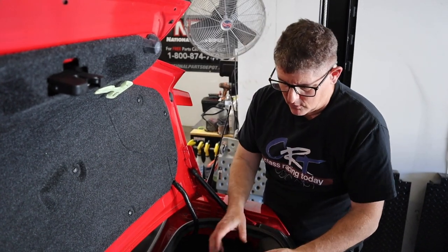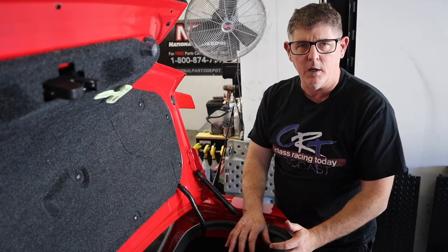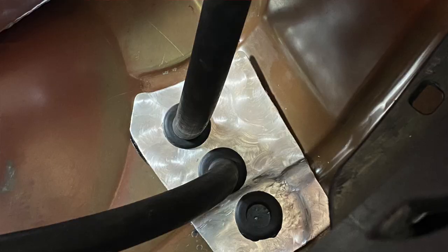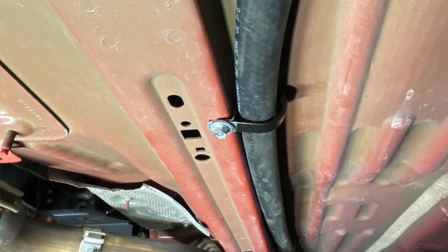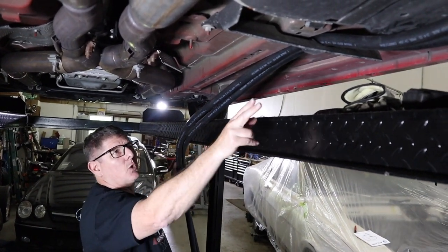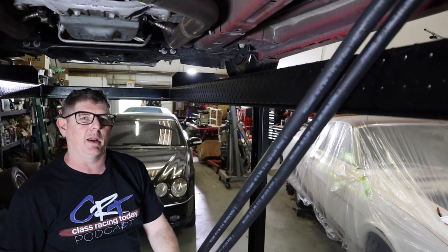So we're back to the trunk of the car. Abe's doing his handiwork back here. We're going to drill three holes — one's going to be the feed up to the front, one's going to be for the return back to the tank, and another one is going to be the tank drain, because you do have to be able to drain the water level down lower if you want to refill with ice. We measured out the hose. Abe's set it up in the trunk where it's going to be mounted to the pump and to the tank for the feed and return. We've notched out a spot and come down through — it's a little bit tricky because it's very tight under here. You really can't have it near anything that's moving or near the exhaust system. We're working with some three-quarter inch hose here — it's not small stuff, but it's going to flow real nice. We'll tuck it up to the car, run it up next to the frame rail, feed it up into the engine compartment, make our proper connections, then do the wiring, and then we'll be ready to run.